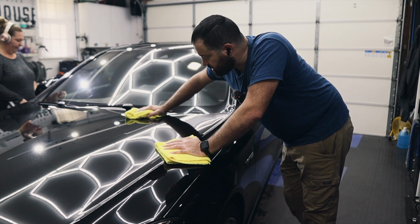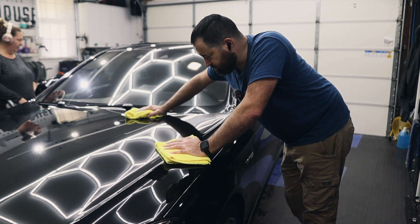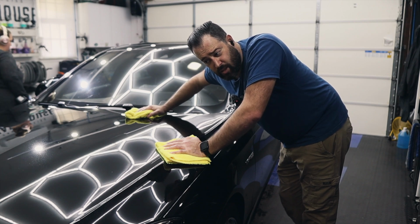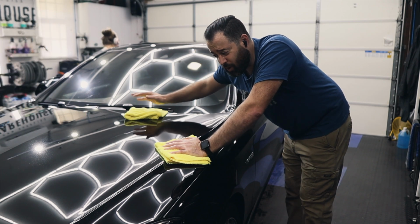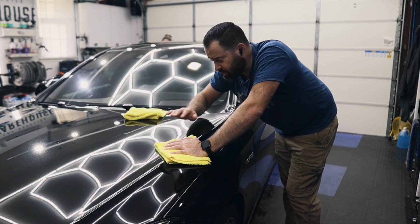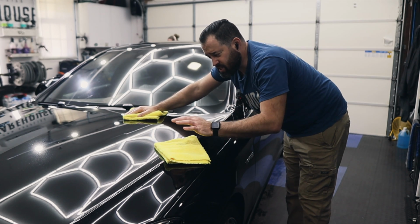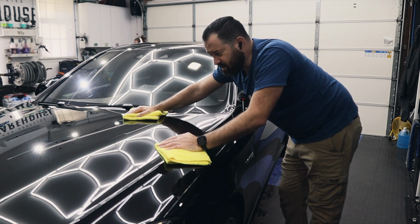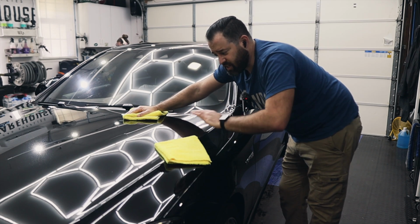In some cases, when we need to use something with more aggression to remove scratches, the 150 does really good. And we'll just put 1 drop or 2 drops of 150 on the yellow pad, the same pad that we're working with, and just use that to compound an isolated area, blow out the pad, and then put more NSP 45 and continue working.